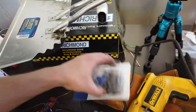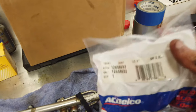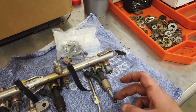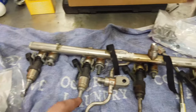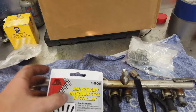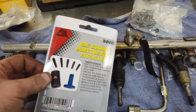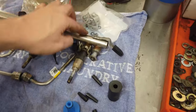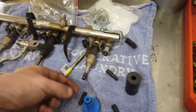I went ahead and bought two seal kits. The part number is ACDelco 12656933 - it comes with both teflon seals and the O-ring that goes up top. Here is the tool: I found this one on Amazon - CTA 5008, good for GM and Subaru, compatible with GM 5362 with Bosch, Continental, and Delphi fuel injectors. It comes with all these little adapters that help you slide the teflon seal over the end of the injector - they butt up like this and help you slide the seal right onto the injector.